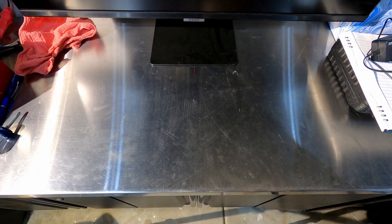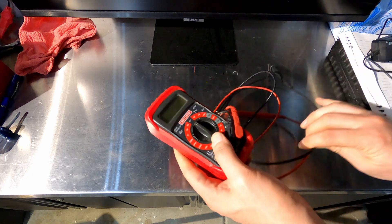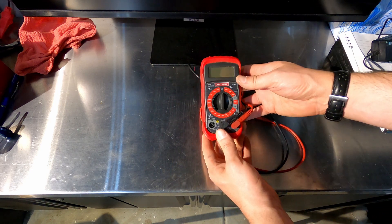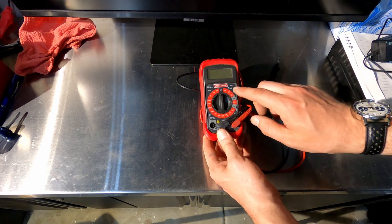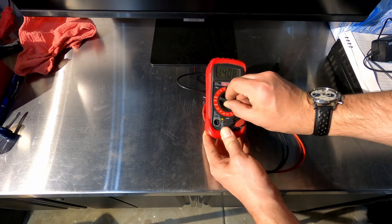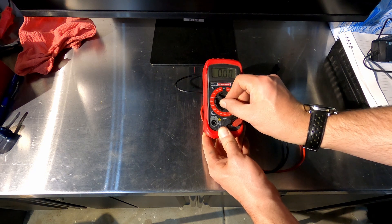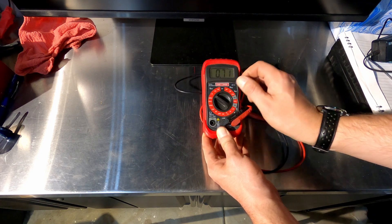The first thing you're going to need is to get your tools out — start with your voltmeter. This is mine, or one of mine. There are a whole bunch of different settings. The section we're concerned with is going to be this DC volt range. This gives you an idea of the range you're looking at: you can go with millivolts, 0 to 20 volts — that's the section you'll probably use most often with your car.